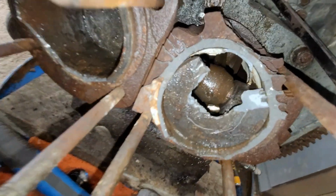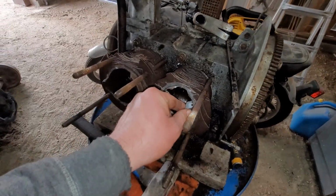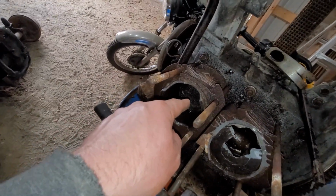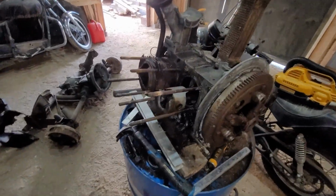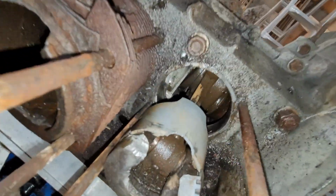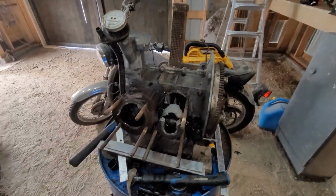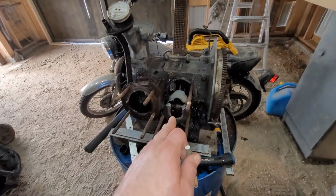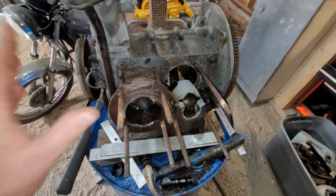Yeah. Good news is, bottom end looks pretty decent anyway. Piston is loose now. Can't really see it, but it slides back and forth. Took a lot of beating. This one here being stuck all the way in, the idea is to get the cylinder out when this one moves. Oh yeah, that's a pretty good hole there. And looks not rusty in the bottom end. Sprayed some penetrating oil, shot through to hopefully get the other cylinders. So now, if the other side is not stuck, when I press this one in, this guy should come out. Because it's loose. I don't know.